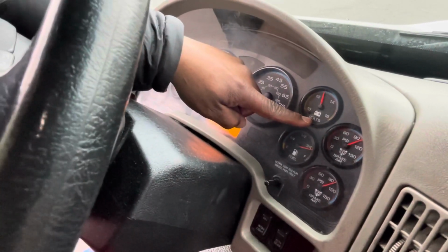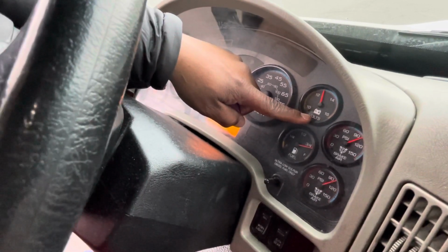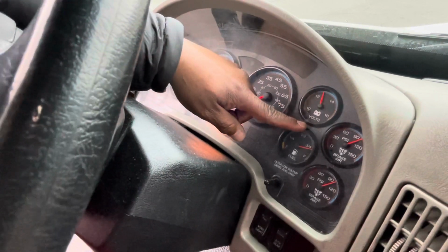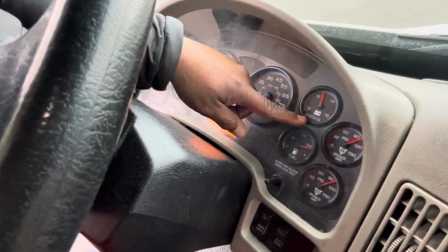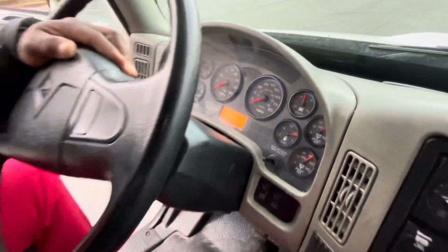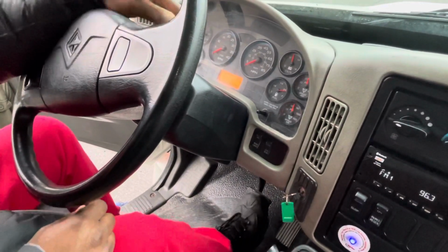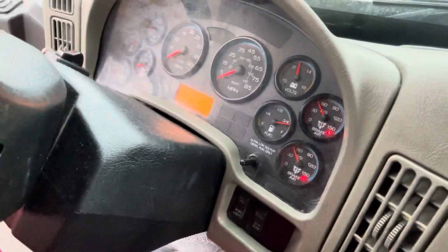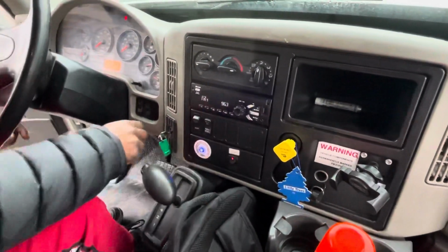When I get to 60 PSI, the low air pressure buzzer and indicator should come on. And then I will continue to fan down to 40 to 20 PSI, and the parking brake that I pushed in should pop out. I'm starting now. Now, they properly work. Keep fanning until the brake pops. Now look at the brake. All right, you just heard it pop out, so it properly worked.